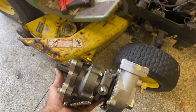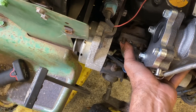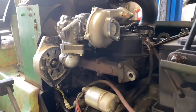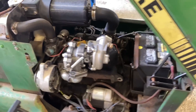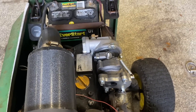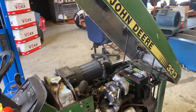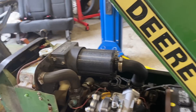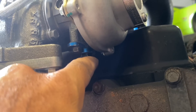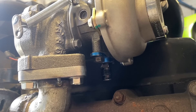Let's see how this fits - go ahead and put this on. Oh yeah, look at that! This is the first glimpse of our turbo setup and I think that's a good fit - nice and tight, super close. Oil lines are going to be my issue here because the drain is right in line with the valve cover, so I'm going to have to come up with something.